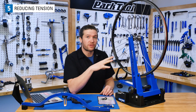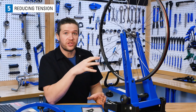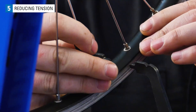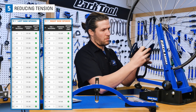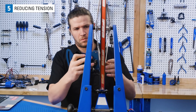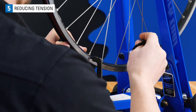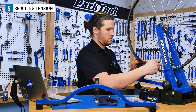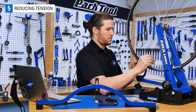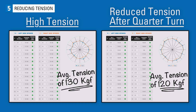If when measuring your wheel's relative tension you find that the tensions are too high, you're going to need to bring those tensions back down. The process of reducing tension is very similar to increasing tension — you'll just be turning the spoke nipple the opposite direction. The tension of this wheel is too high by about 30 kgf. Because this is a front wheel with equal bracing angles on the left and the right side, loosen each spoke by one quarter turn. When spoke tensions are this tight, a quarter of a turn will lower spoke tension quite a lot. Go around the entire wheel like this and then recheck your tensions. Using our TM1, we can see that our tensions are already down to 120 kgf.